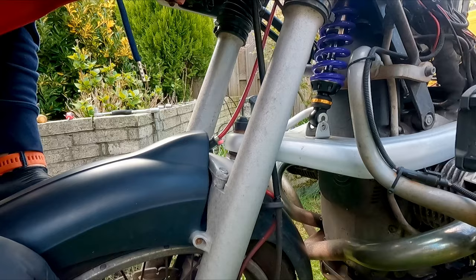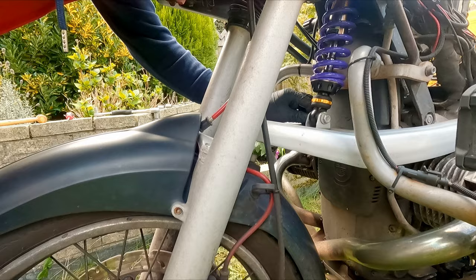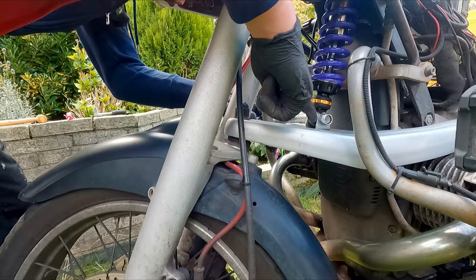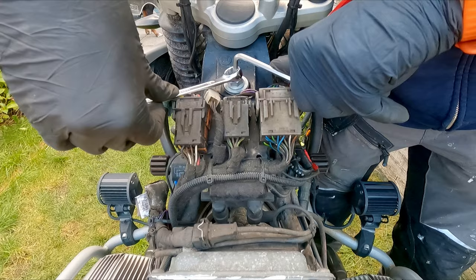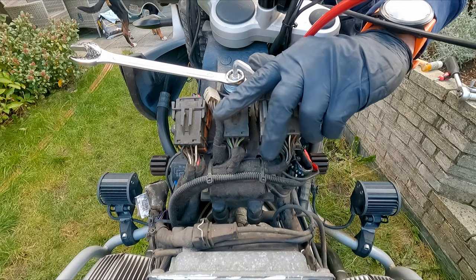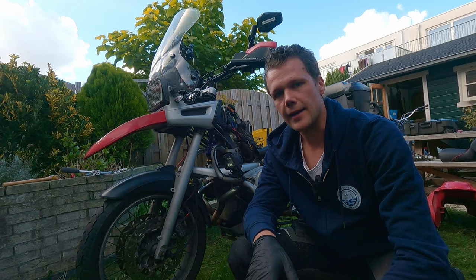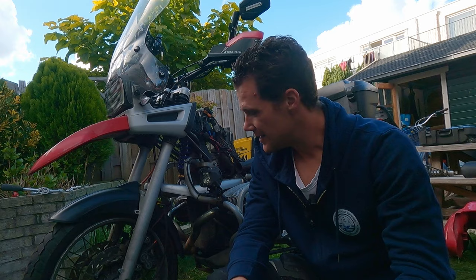Put the lower bolt in again — not easier than expected. Hopefully the standard preload is sufficient, because it will be a bit of a hassle — I don't think we can adjust the preload on the front side on the fly. So that looks a lot better. Put the tank back on, and next time I will check the sag of the bike. Next video I will adjust the static sag, and then after that we can go for a ride.